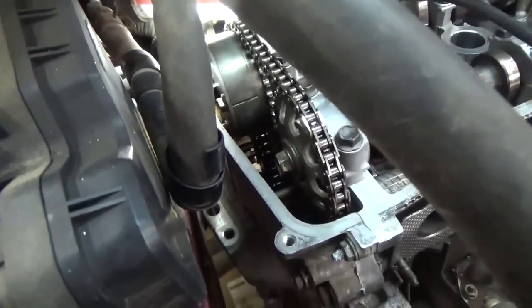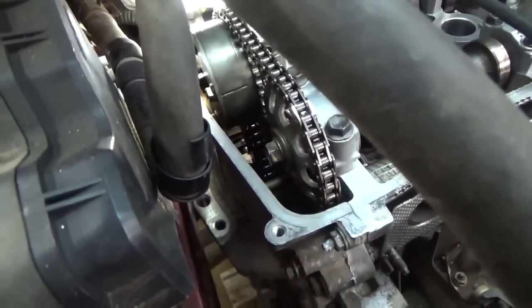a little bit of protrusion. I guess if you can kind of decipher what you're looking at, like I say, that gray pin is the top of the hook, and you can see the piston there of the chain tensioner has poked out a little bit. So that's exactly what we wanted it to do. And I guess rolling the engine backwards would also accomplish the same task.